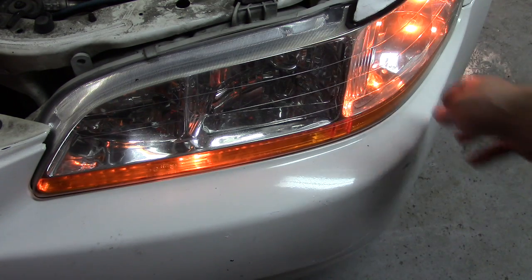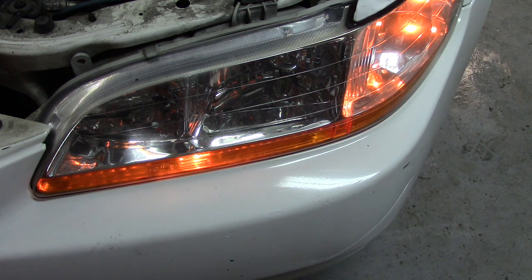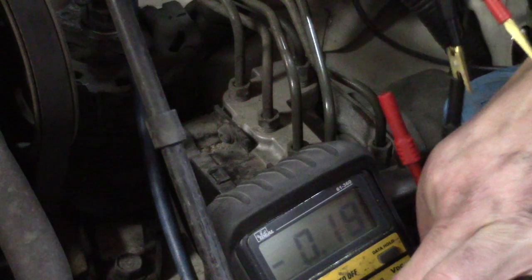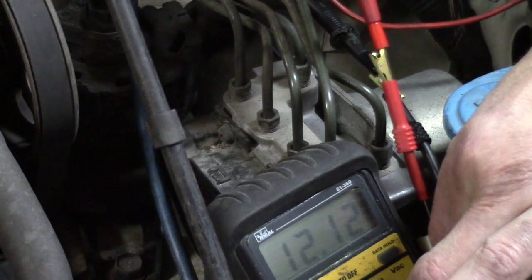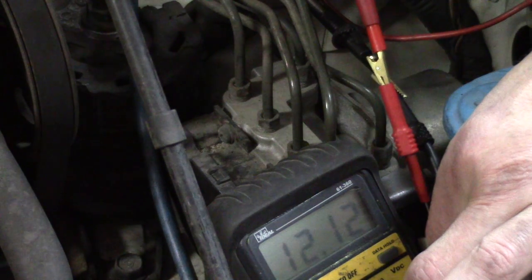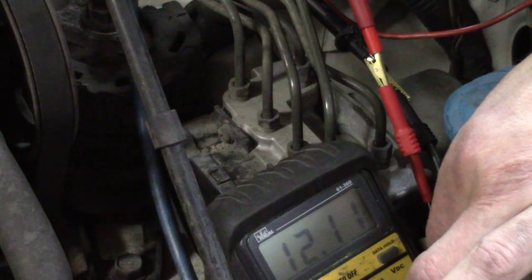So I've turned on the lights. We can see the parking light turns on, but we do not get the headlight turning on. So obviously most of your hacks are just going to go ahead and replace a headlight bulb. Of course, the guys on my channel don't do that. We're going to go ahead and verify that we've got 12 volts at the socket. So I'm just going to go ahead and unplug this socket here and look for voltage. Pretty much a no-brainer — we can see we've got our 12 volts pretty clearly right there. So obviously we would come to the conclusion this bulb must be bad. Most everybody is going to change this bulb at this point, except for a very few people who are going to make the assumption it's still possible we might have a voltage drop.